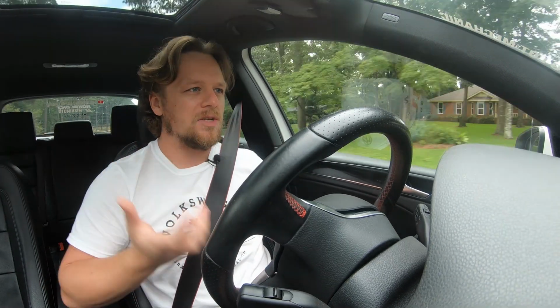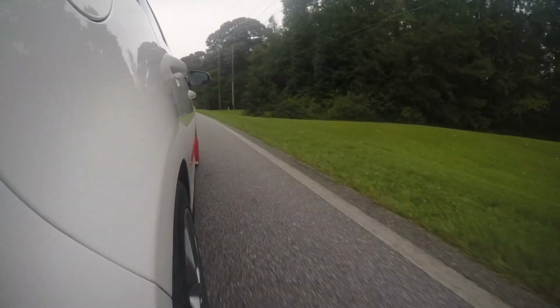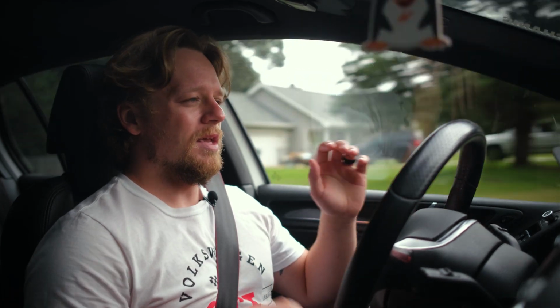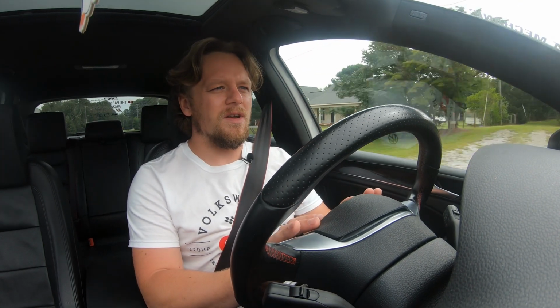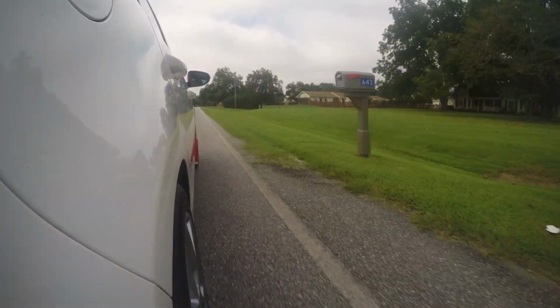And because that whole side is being brought down on the inside of the turn, the inner front wheel actually has a better contact patch as well. With that improved contact patch, with that improved stiffening, the turn-in is back. That responsiveness is there again, and it is just as amazing as I remember it. I absolutely love how this car handles. It really does have a very, very, very sporty feel to it, unlike anything I've ever driven.